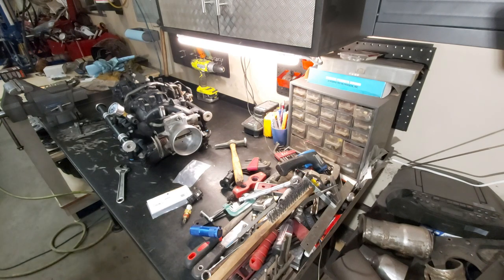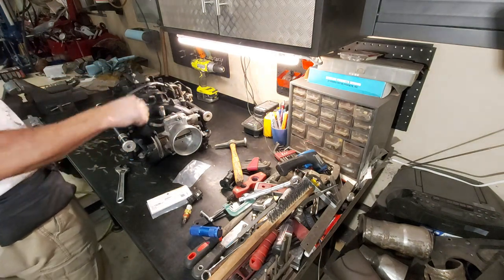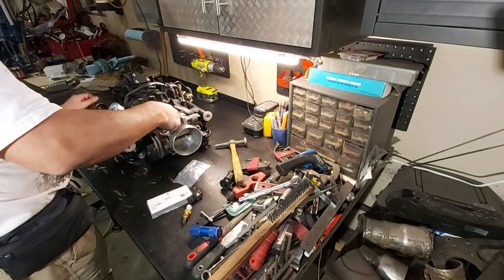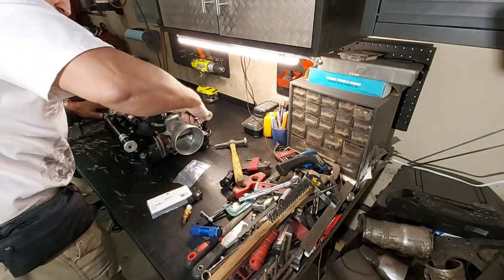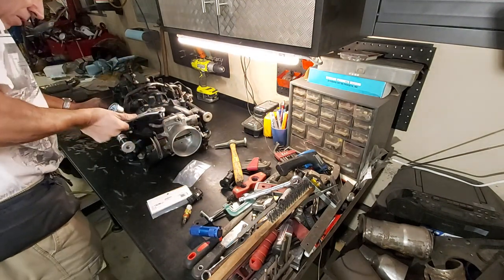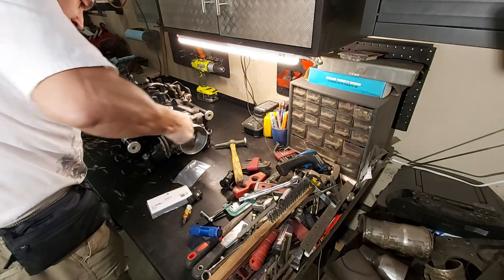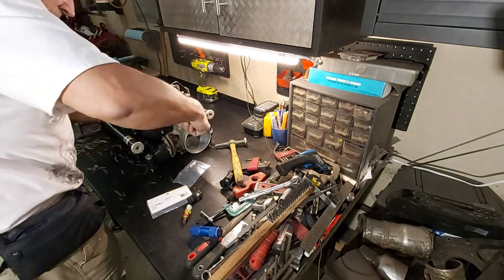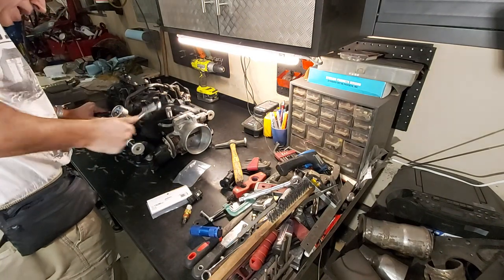Okay, guys, so anyways, what I did is I opened up this hole diameter a little bit better just to get a deeper seat with the tap, and it seems to be grabbing better now, so we'll see how this works. I just couldn't get any meat before. Yeah, I think we're good here. Don't have to sleeve it. At least now we're into the deeper part of that hole, so there's more wall thickness, so it's actually pulling the threads with the tap down.